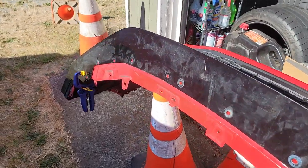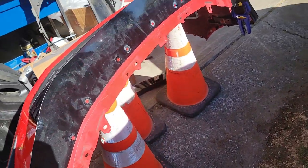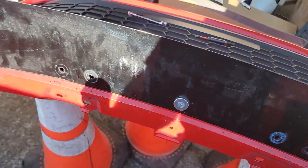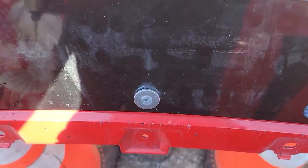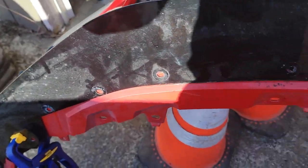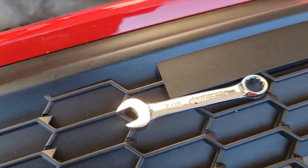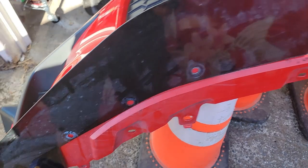If you're going to be doing this, I highly recommend you at least have sawhorses and a person to help you. Right now I've got it clamped and set up on some cones. I spent about 45 minutes making sure everything was lined up, then started with the top center and the two closest sides, leaving the clamps on while drilling. I'm using a Phillips head with my impact gun as the drill, and a 7/16 wrench to make sure everything is tight.